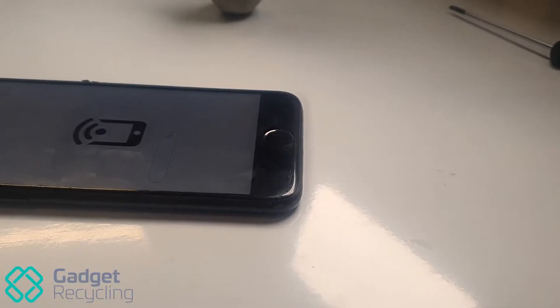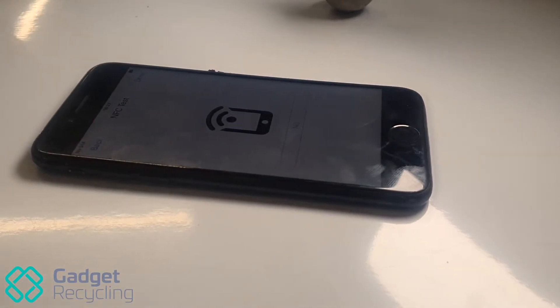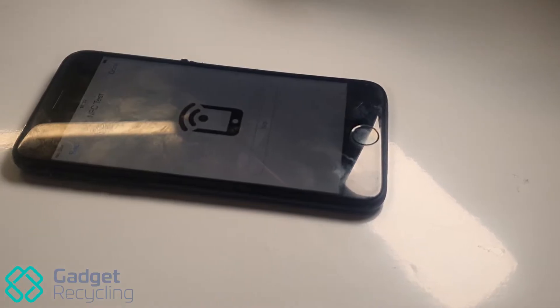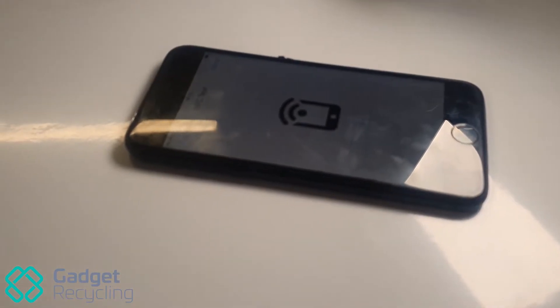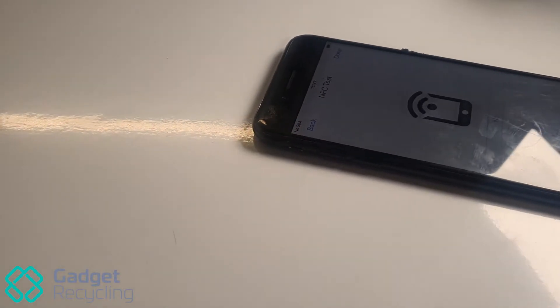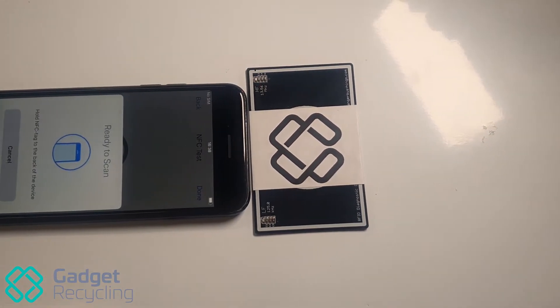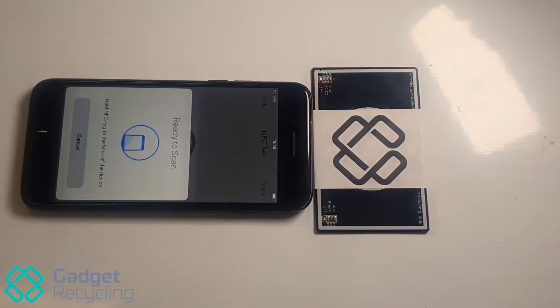As you'll see, it can often be rendered useless during simple repairs such as a display swap. The system works as a single looped circuit and faults are very often the result of either shorts against things such as the back plate of the display, the housing, or it can be the result of a poor contact. This can happen on any link of the chain throughout the circuit that the NFC takes.